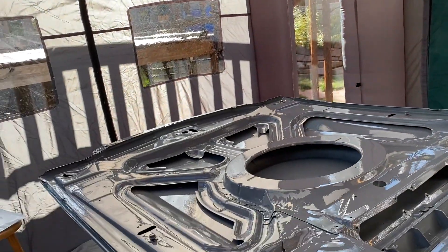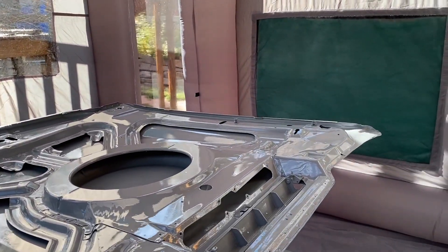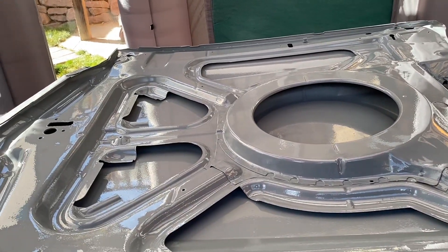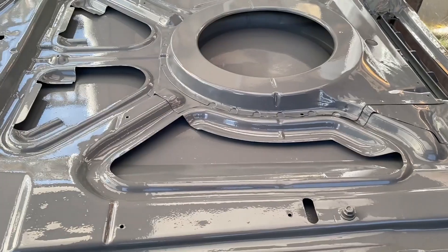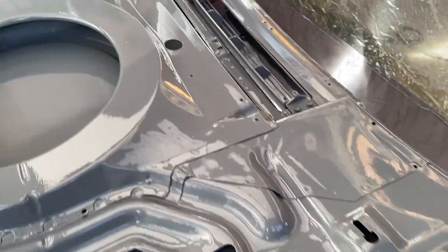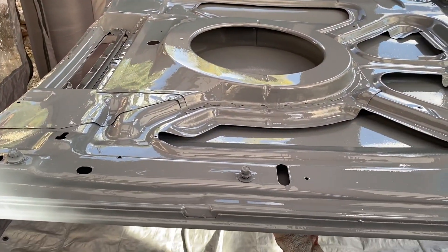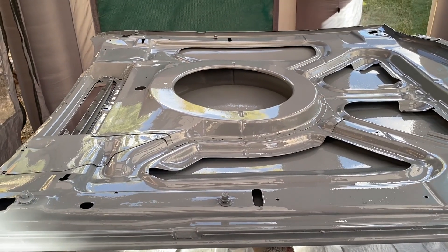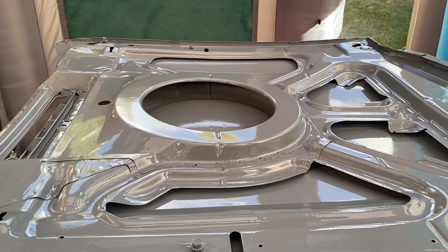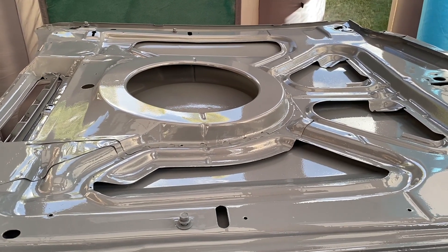Let's go inside and take a look. As you can see, the fog is gone — as most of you know how foggy a room can get when you're spraying clear coat. Two coats base coat, two coats clear, and the back side of the hood is done. For those of you following the Sewell Garage Chevelle project, this is the color I picked — it's the cement grey — and I love it. We'll put some black SS stripes on the other side of this hood. It's continuing to filter the air as the hood dries, which is a great clean place to let parts dry as well. The noise really isn't too bad, even though it sounds quite amplified in this video.